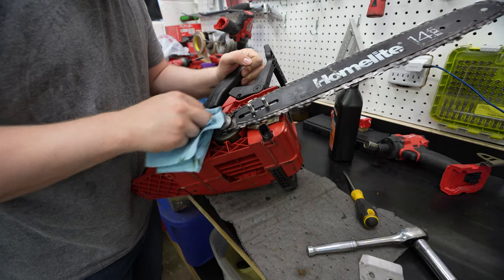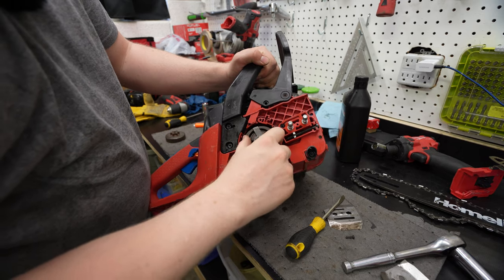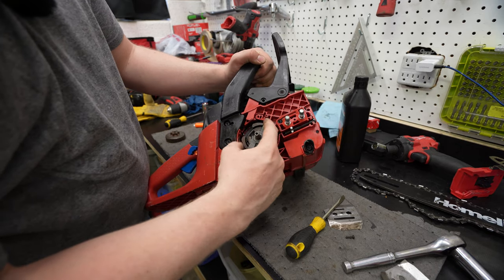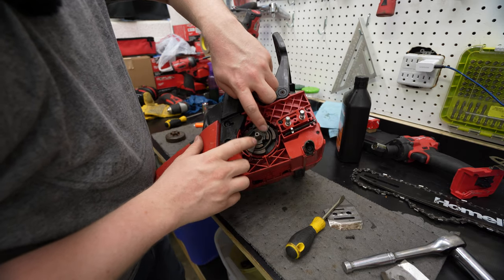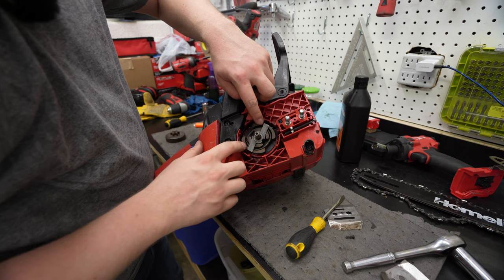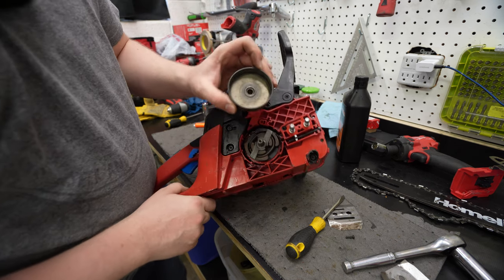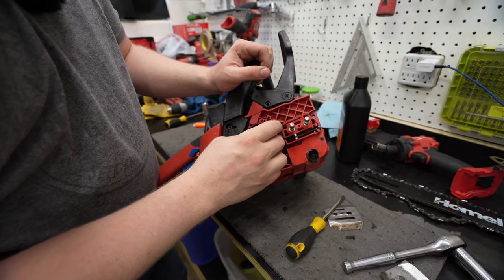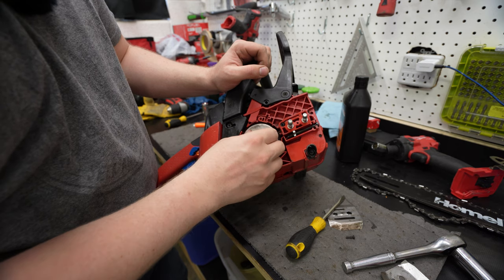So that's good. If you didn't know how these clutches work, this goes straight to the crankshaft, and there's this big spring with these shoes. As it spins, centrifugal force pushes these pads out because the spring is holding them in. And then it rubs against the outside of this drum. Bada bing, bada boom. It's a clutch. So see, right now the shoes aren't grabbing.